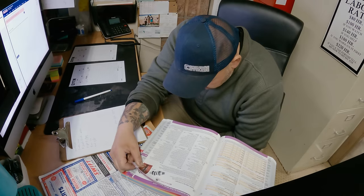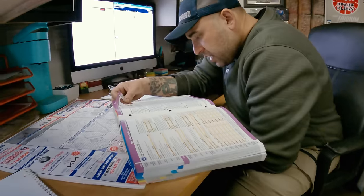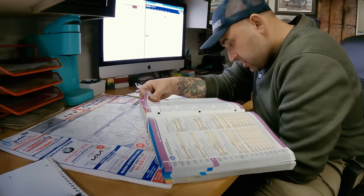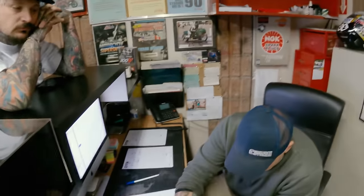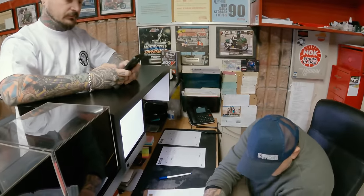So the 592 has a 2850 to 6250 power band. The 538, 2250 to 6250. If you want to go Feuling, it appears the biggest they have is 592, or you go one under the biggest, which is a 538. Which, for the record, S&S uses a 550 grind cam for their power pack kit. Yeah, which is just a 128 without cylinder heads. They claim that a 550 is the best for it.